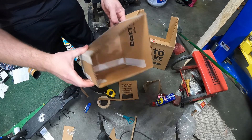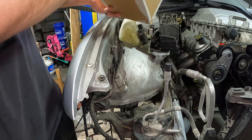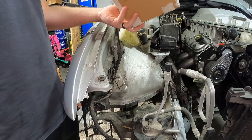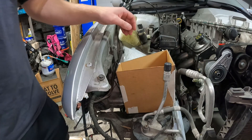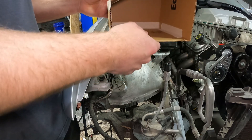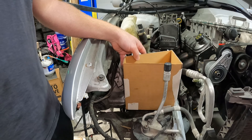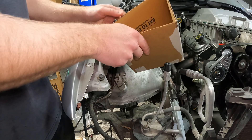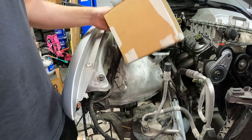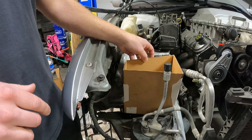All right, version 2.0 — let's see how this fits. I need to do the math here. I can turn that shape into a triangle and a rectangle and do a little math to see how much it's going to hold. So I just did the math: 232 and three-quarters cubic inches — so almost 233 cubic inches of water displacement. Converting that to liters it's 3.8 liters, and converting those liters to gallons I get exactly 1.01 gallons. This should be pretty easy to model in AutoCAD and have cut out and welded together.